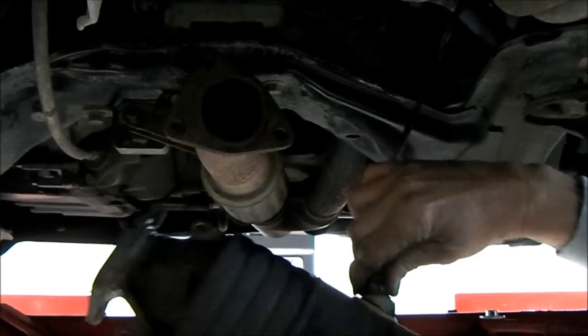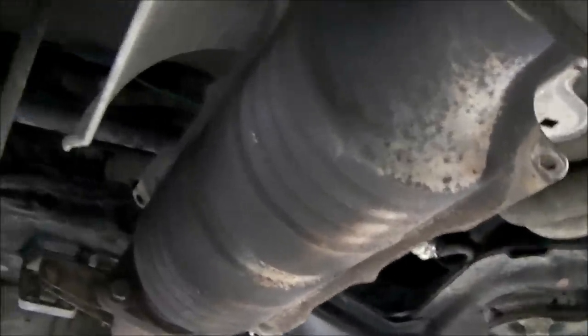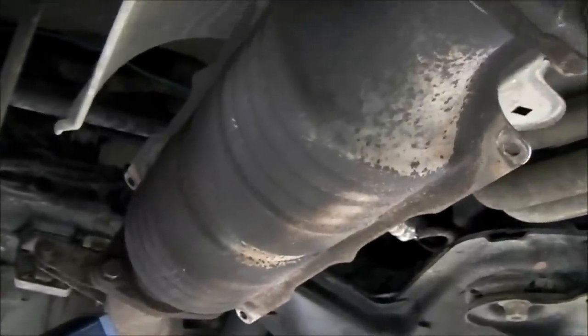With that O2 sensor, you need to twist it up, or just fit it in that way — get it up in there and then tighten it. So we've got the cat in and the engine's all warmed up. We're doing a temperature test on this cat just as a preliminary test, because if we don't see satisfactory numbers here, there may not be any sense in actually going out and driving it around.